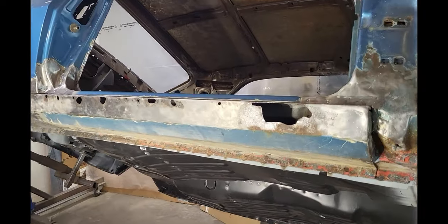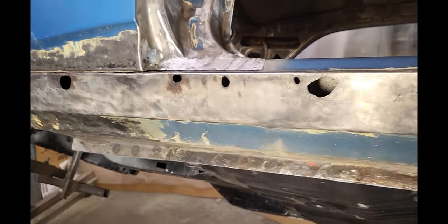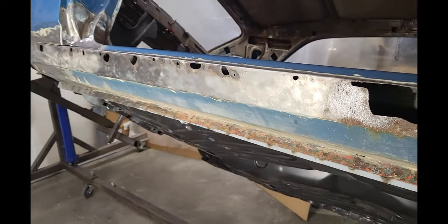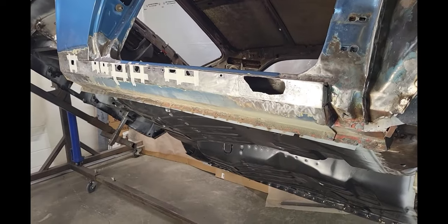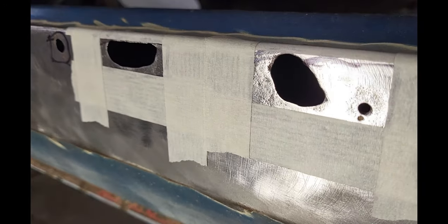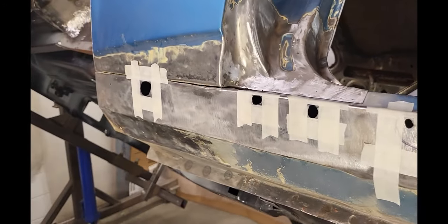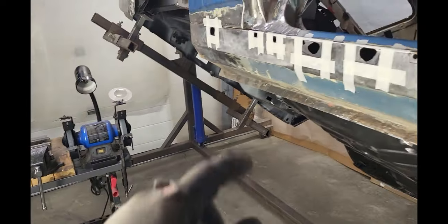The rocker on this side is not nearly as nice as the one on the other side — big hole here, a bunch of smaller holes all the way down. First thing I'm going to do is bust out a clean-and-strip disc and clean these all up, see kind of where I'm at, see what needs to be cut out, see what's good metal. I cleaned up these areas, got all the paint and rust off of them, then taped them up outside of where the pitting was. I'm going to start making patches now.